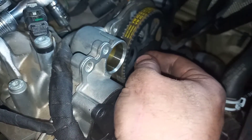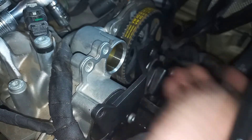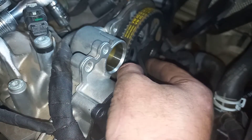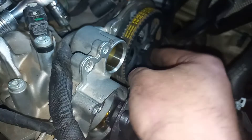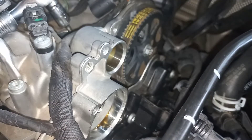Flush to the position, parallel to the back side. You might need to give the belt a little bit of a wiggle due to the internal stresses, but that should come in just as it should be. It's a bit tight to fit, so we know that our timing is set perfectly correctly.